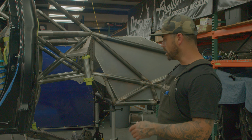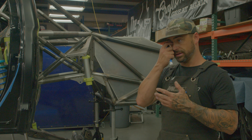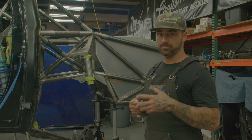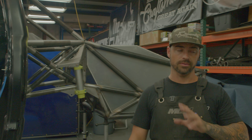The sweet spot is like 124 to 126 inches, which is what a lot of trophy trucks run. A lot of extra cab pre-runners are at 135 and usually have a shortened wheelbase, so getting this thing to 135 is an awesome place to be. I'm not going to go into too many details — just covering that.